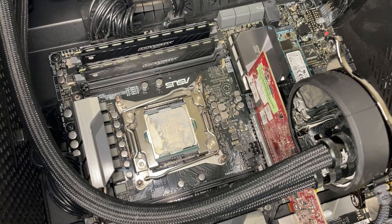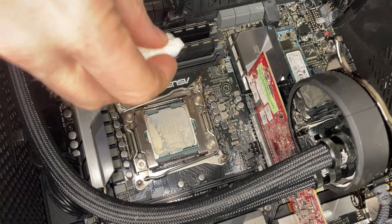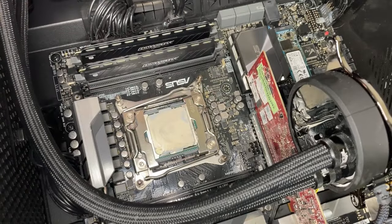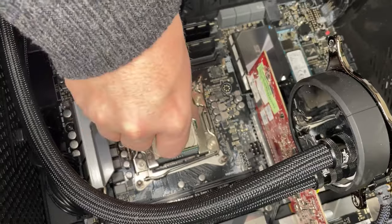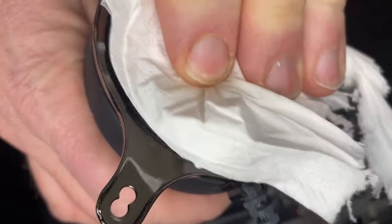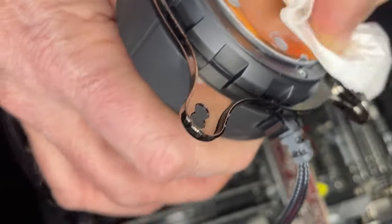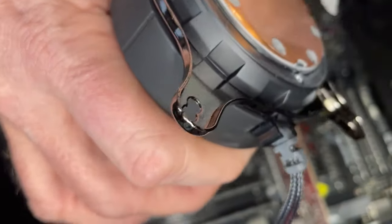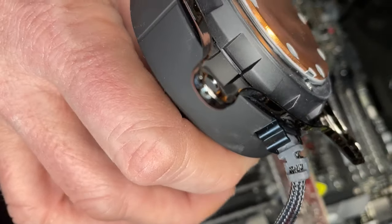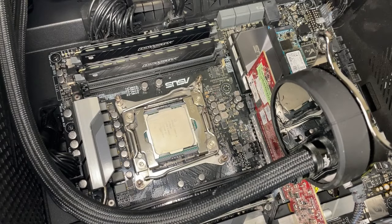Let's get rid of that then because that's no good. I'll put my magnifiers on to see if I can get rid of this paste. There's thermal paste on there and it's gone a bit funny. I still don't think it should be getting to that kind of temperature, so it leads me to think that maybe this unit is dead. There's plenty of heat there and it's really blindingly hot, but I suspect this is not taking the heat away — and that's the problem.